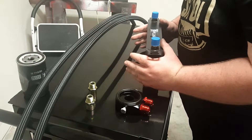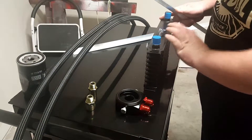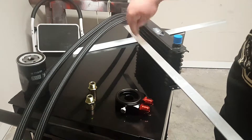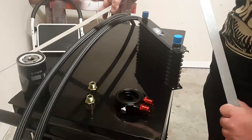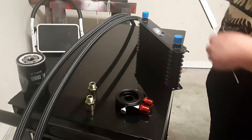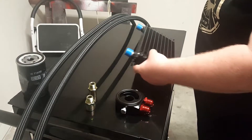I want a venturi effect, so the air is coming out really fast at the back and it's sucking air in the front, and gets pushed also from driving. So I want to make a frame around here, mounted on here, and make a little frame at the back, and then go with these things from the frame down to the other little frame, which I mount straight to that little hole where the foglight is sitting normally. Then I cover it all around with aluminum sheets and weld it all together. That's the plan right now — I have to see how that turns out.